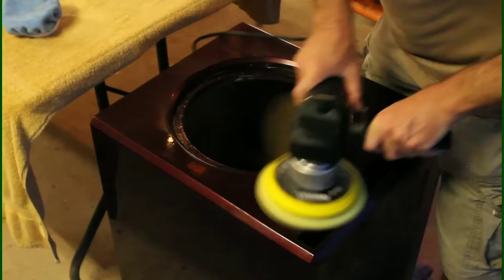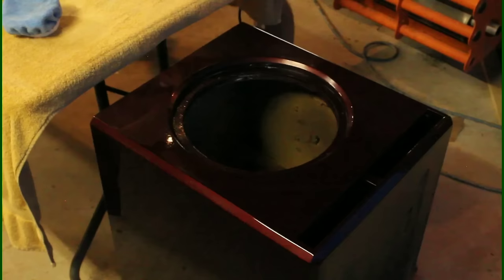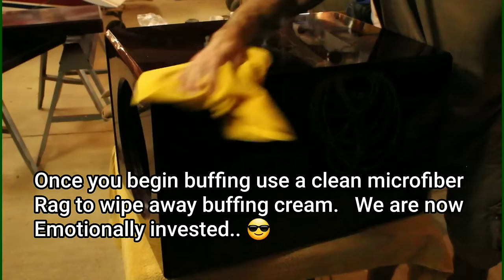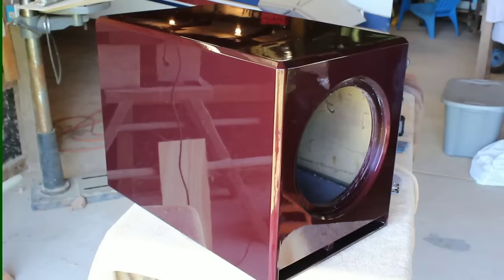It doesn't take long, because our compound was done so well. I mean, man, look at that. That is a really nice look at that depth. But the compound did so well. This step right here, we're just icing the cake real quick, just making a single pass on it. It's not taking us long at all. My video camera actually stopped, so I didn't get the entire process, but you pretty much get the picture. You're just going to put a few drops, make your crosshatch patterns, buff it out, wipe it off, and you're done.